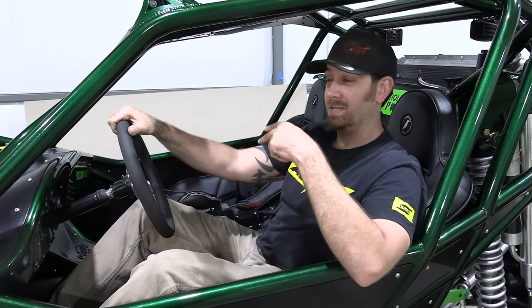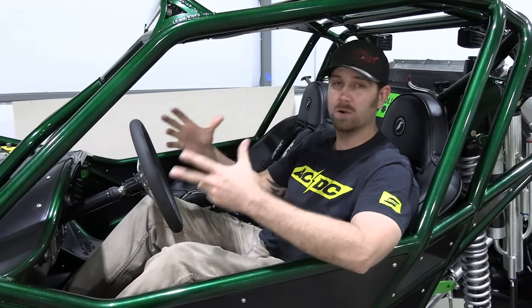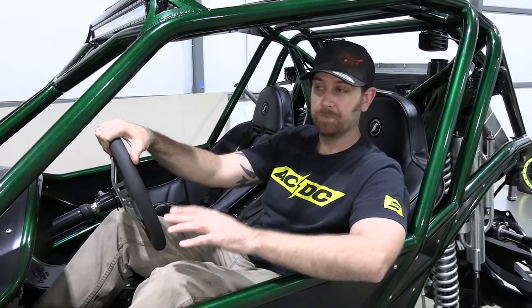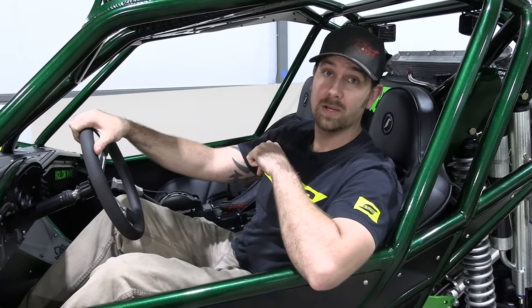Another reason is those big vacuum boosters, they're just ugly. They're huge, they're hard to package, they're really ugly, and they don't really work that well when it's all said and done. Third is a manual brake system can be very difficult to get right. There's a lot of trial and error that goes into it, a lot of mathematics and things, but if you grab a Hydroboost unit, plumb it in your system, and you do what we're talking about in this video, I can guarantee you that you'll have great brakes at the end.